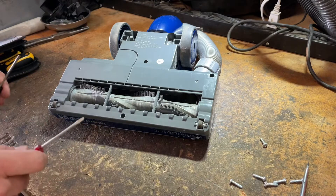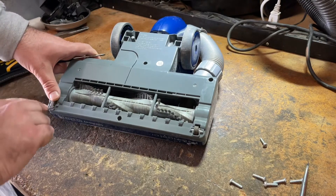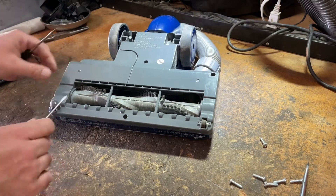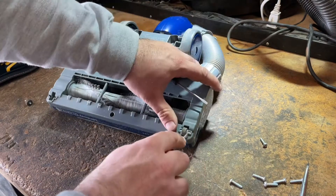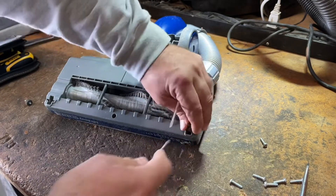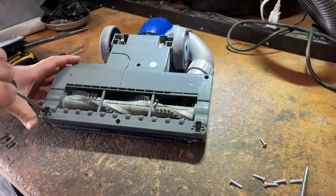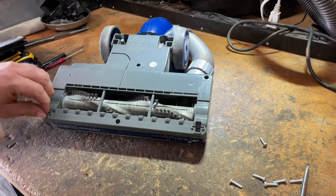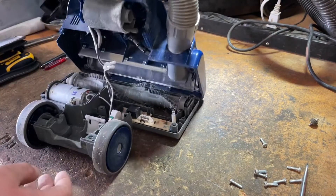To remove these wheels, very carefully with a flat blade screwdriver, you're going to want to very gingerly work these two rods out, just like that. Same on the other side. You don't want to over stress them — there's no need to. Just like that — you don't break anything pulling them out. Then I'll just remove those two screws, and it just pops off.